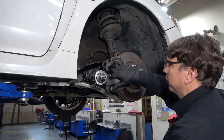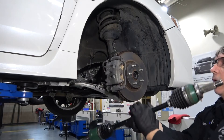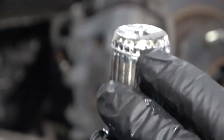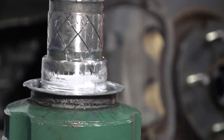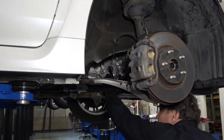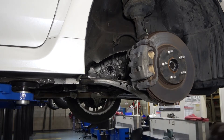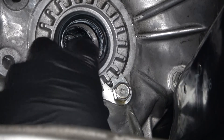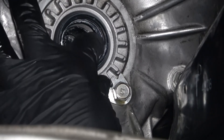You may need to lift the steering knuckle and brake assembly out of the way to remove the axle. The circlip and axle splines can now be inspected for any wear or damage. Additionally, inspect the surface where the axle seal rides, making sure that it's not damaged. Then inspect the axle seal that's in the transaxle — run your finger across the seal, feeling for any nicks or cuts and checking to make sure that the seal is still pliable.